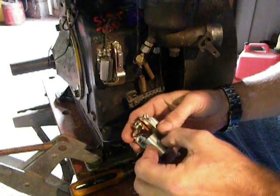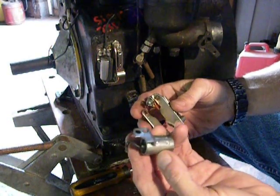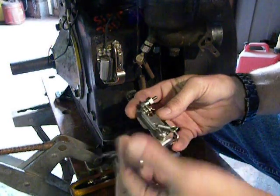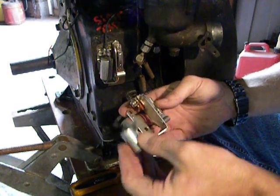This particular set's still in good shape. When I strip my engines down, I check for spark and make sure I've got good surfaces on the points. And if I do, I throw them in a drawer for later. This set's barely even been used.